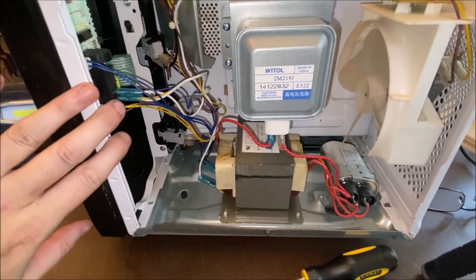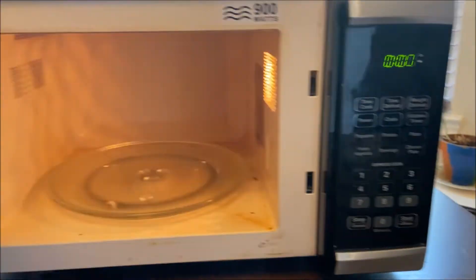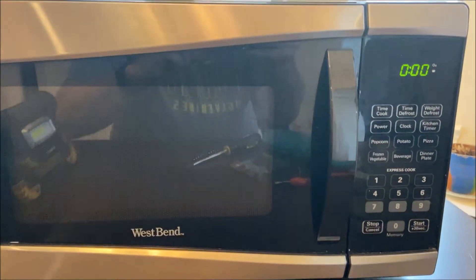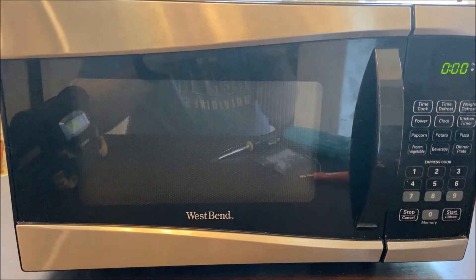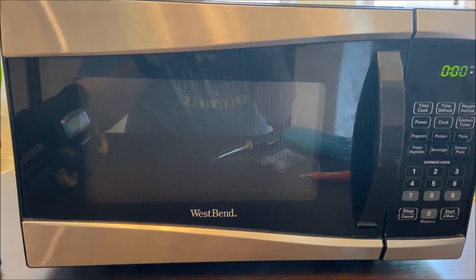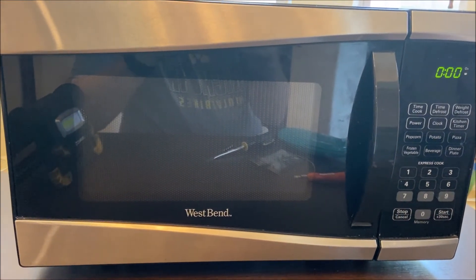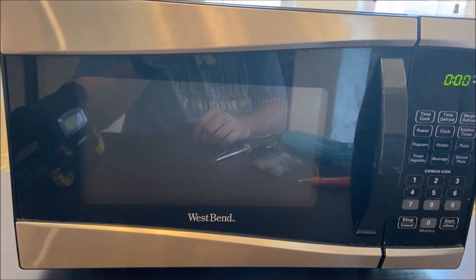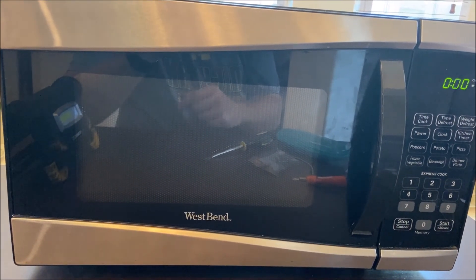All three switches are replaced. I go ahead and slide the cover back on, put those screws back in, plug it in and see if it works. It's all put back together and it still doesn't run on its own when the door is open, but it does actually run — so it's no worse off than before. For less than ten dollars to get three new switches, hopefully it has fixed the problem — it's a lot cheaper than buying a brand new microwave. Hopefully this video has been helpful. Give it a thumbs up, subscribe to the channel, and hit that notification bell. Thanks for watching — you guys have a good one!